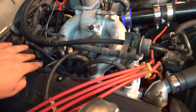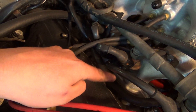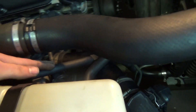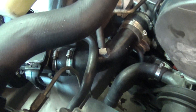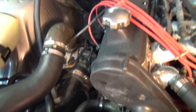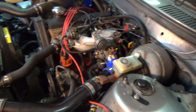This goes into the oil separator, and then there's a crossover line going to the block plate, which goes into this catch can. Then there's a little elbow epoxied into the pre-turbo intake pipe, post mass air flow sensor. So it's pulling good vacuum out of the crankcase to relieve pressure. Everything's been cleaned up and the block has been painted.